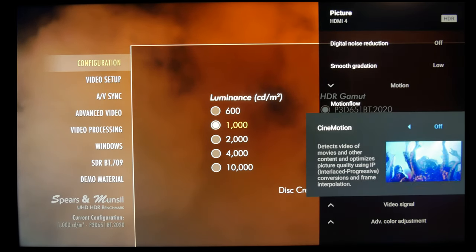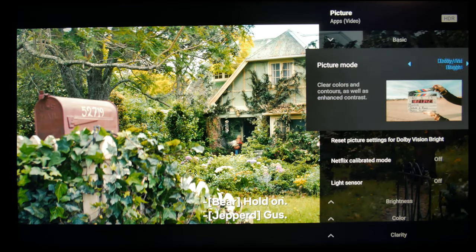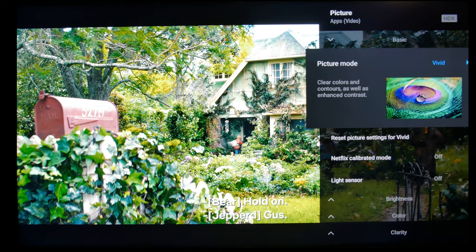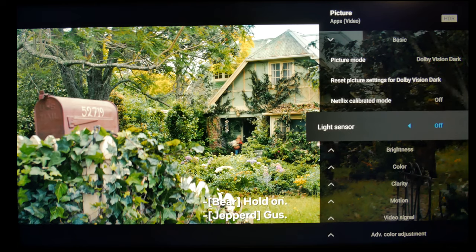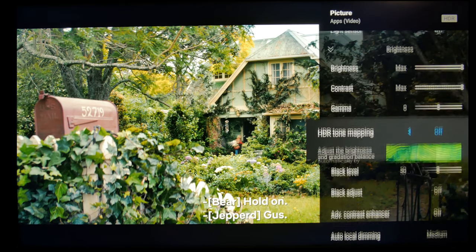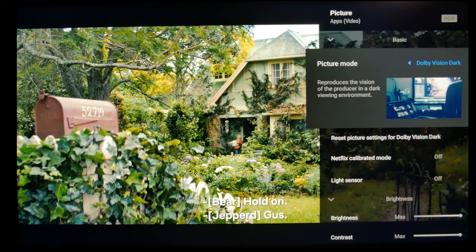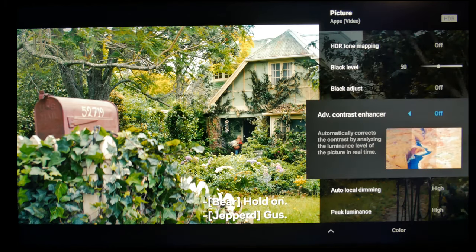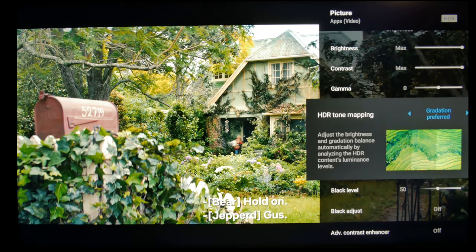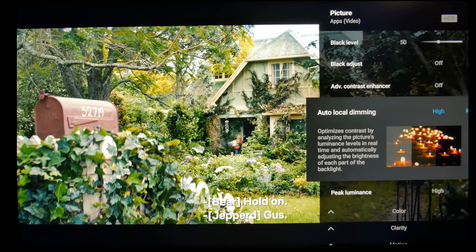Cinema motion depends on your source or how you're actually watching the content on the device. Here in Dolby Vision, these are the three modes. Vivid is way too blue and overblown. Dark is the more accurate setting when HDR tone mapping is turned off. However, in some Dolby Vision content you might find it to be too dark, so you might want to use Dolby Vision Bright, possibly with Gradation Preferred, which kind of puts it in between Dolby Bright and Dolby Dark.